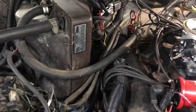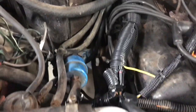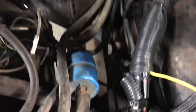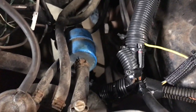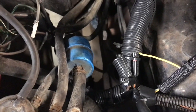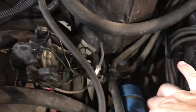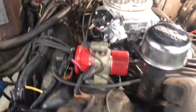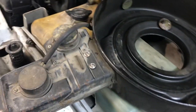Another small thing is the wiring. This main wiring harness comes down and crosses over to the solenoid, but there is a hot exhaust right below there. Make sure your wires are not hanging down near the exhaust because they can melt, ground out, and cause major issues including a no-start condition. You can zip tie them to a bracket. I had an issue where my wires actually melted.